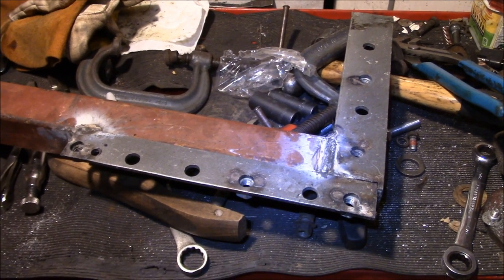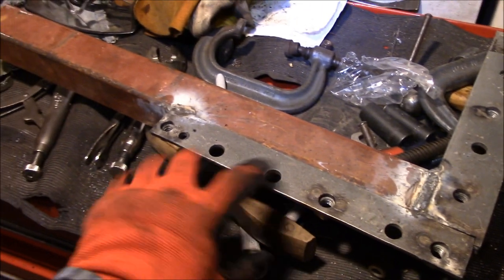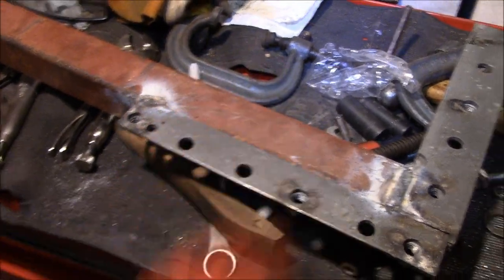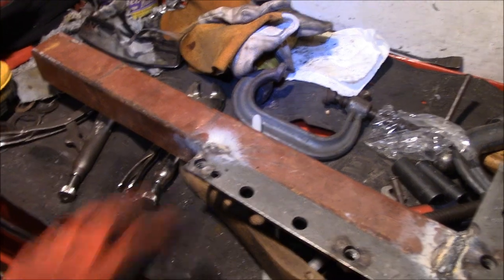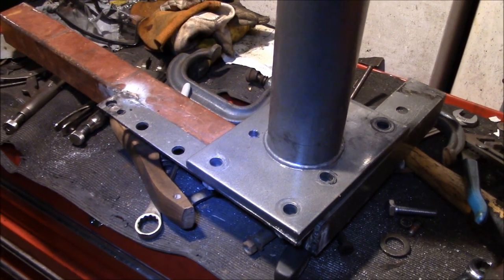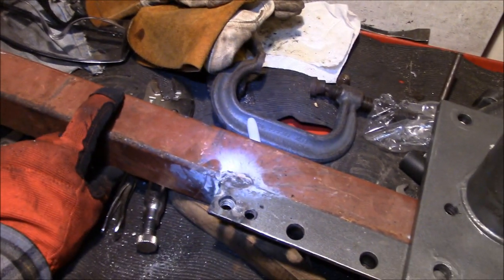After we failed on the first attempt, this is what we got to do to brace it up. We welded the two angle pieces together that go back to the corner of the bed, and then we need a stringer to run from this mounting base over to the frame of the truck. That's what's going to give us the whole stability to keep this thing from wanting to rock in place on that spot of the bed. There's about a million ways you could try and accomplish this — ideally you'd want to run this bar across the two frame rails so that it doesn't teeter-totter on one of them. So that's going to be the sub base that's underneath the bed, and we're going to bolt down through the bed, through that cross member, and through to the frame.